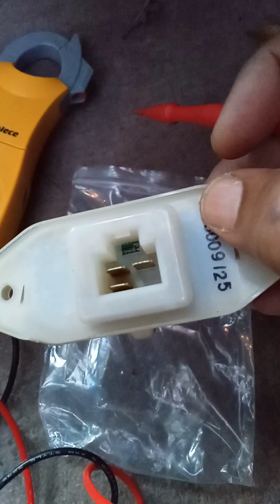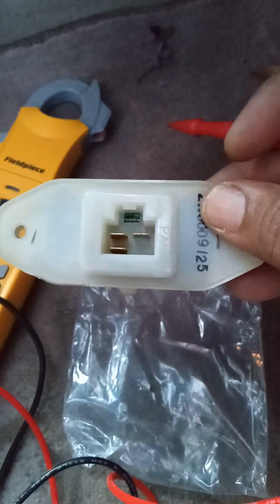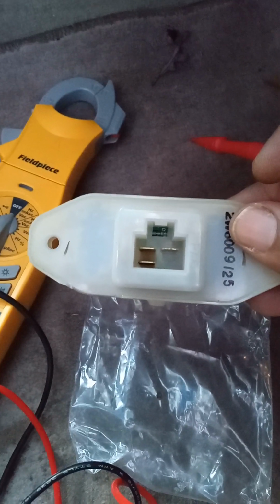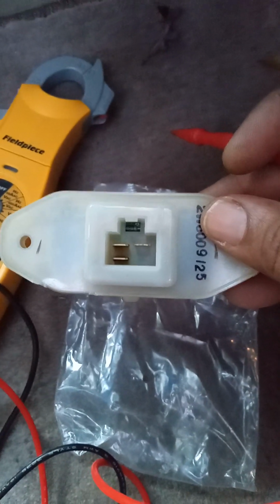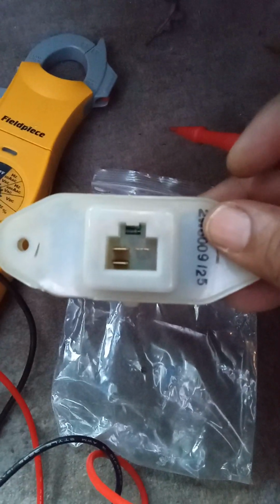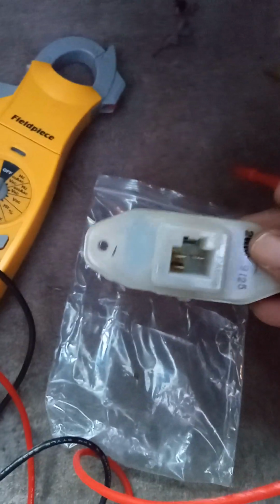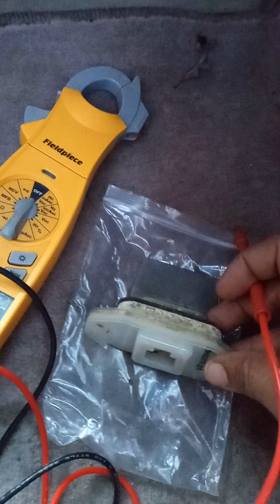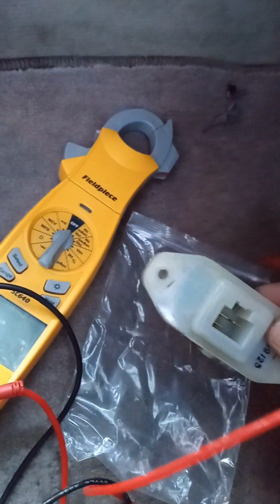But in my case, my fan motor is bad too. It's binding. It's like grinding. You can hear the bearings. I don't want to turn it back on because it's pretty terrible. It's a really grinding noise. So I don't even want to turn it back on because I don't want it to blow my resistor, because maybe it just binded up and overheated the resistor or something.